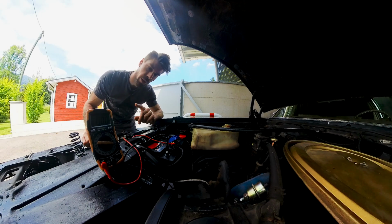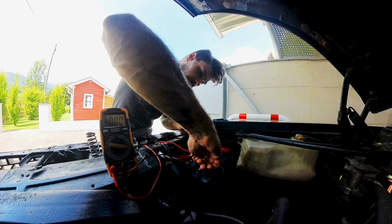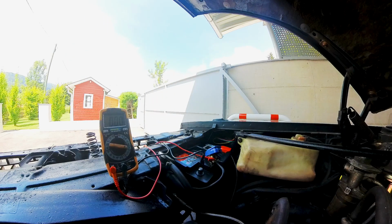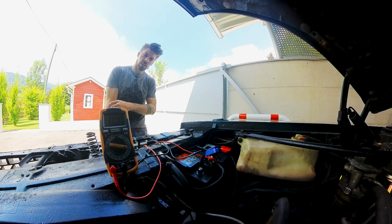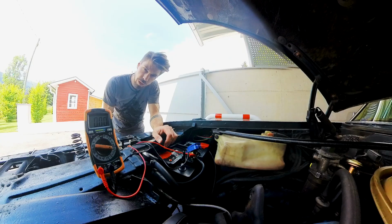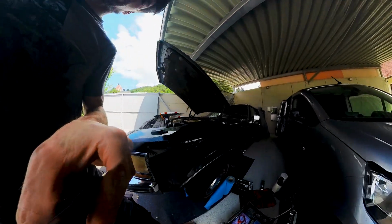I'm connecting the purple wire and we test again. Purple and positive wire are now connected. Let's test this. Again, I'm pushing the door trim button. Wow. Let's connect the brown wire next. But it's interesting that this drains the battery even more. So brown wire is connected too. So let's test once more. Door trim button in, main switch on. 1.26. Well, it got worse. Let's bolt in the starter motor all the way.